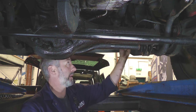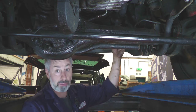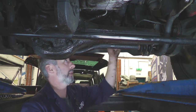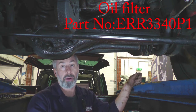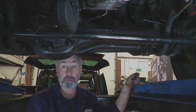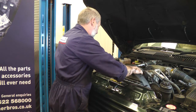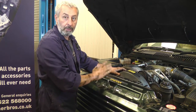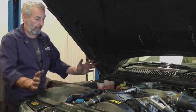I'm going to replace the two M8 bolts in the bottom of the radiator mounting brackets that we took off earlier. Then replace the bottom hose — dead simple, place it on the radiator and tighten the spring clip. Then I'm going to replace the oil filter — I'm going to fill the oil filter with oil first, because we've had the oil pump off and just to help prime it. The last thing to fit is the cowling that goes on top of the fan — once that's in place with one clip each side, we're going to top it up with oil and top it up with antifreeze mix.